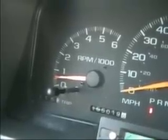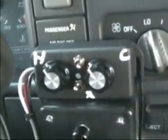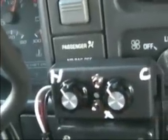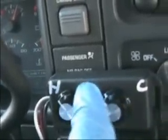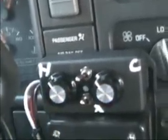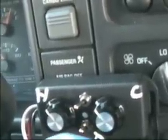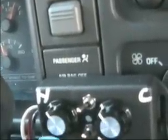You'll need to drive the vehicle as well, because the city setting is for under 40 miles per hour. If the engine starts to ping a lot, you've got it turned up too high and too lean — you'll need to come down. After you get that set for under 40 miles per hour, you would do likewise for the highway by switching it over to the highway setting. Make sure you're not in any traffic and start to adjust the highway knob likewise. If the engine starts to ping excessively, you've got it turned up too high — start turning it down and bring it a little richer until the pinging is completely gone. That'll be your ideal setting for the highway.